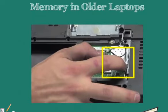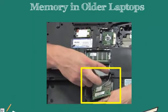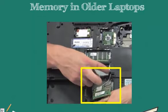The wireless card can also be removed. These wireless cards are typically held in with our shrunken down version of a PCIe type connector. This is the wireless card for this laptop. It can be replaced if need be and is already pre-wired into our laptop. The wire goes up to our laptop into our screen in order to give it a wider range for its antenna, but if need be, it can be replaced.